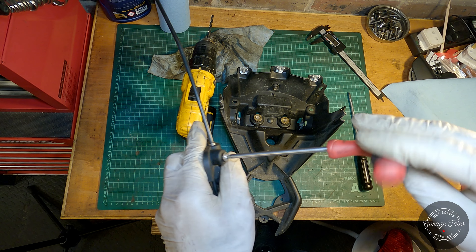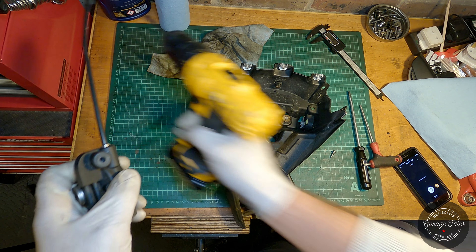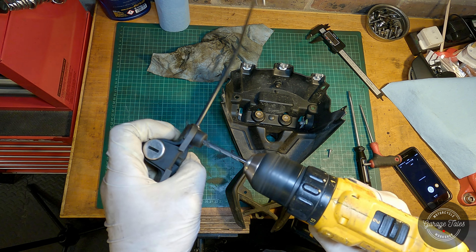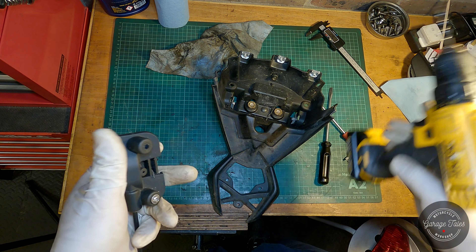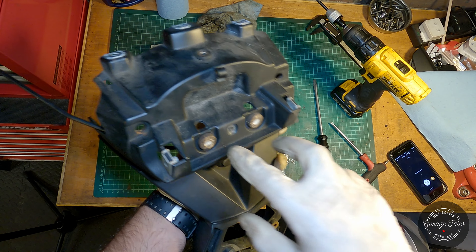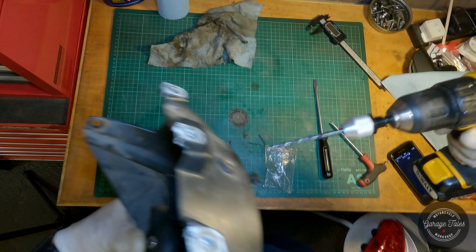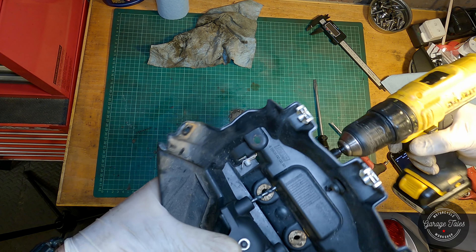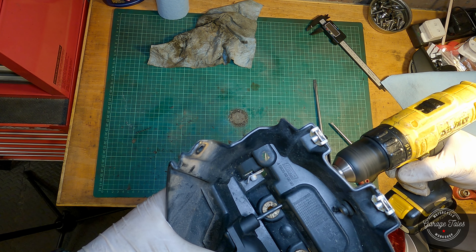This barrel was originally glued on the number plate holder, but I don't want to do that — I'd rather have it bolted together. So I'm going to remove the two screws that hold the plastic housing together and extend the holes through. I can put it in place and fortunately there are two cutouts, probably intended to access the screws I've just removed, and I can use those to drill my holes into the number plate holder. I needed a little extension as my drill bit was too big to fit in there.